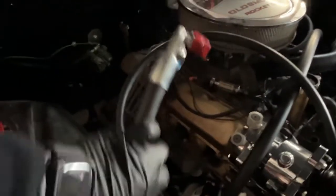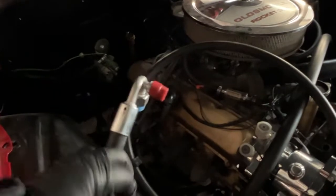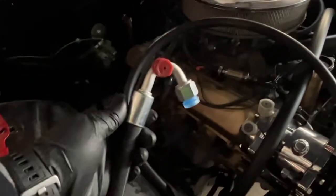And again, here's an installation where you can see it coming out of the firewall. These are the lines that I'll be connecting to the heater to the engine, and this side over here is for your air conditioning system. And then what we do is we make custom hose fittings, and I have a hydraulic crimper that will press these couplers on the end of the hoses at the exact length that I want, so that I can connect them right onto the compressor where I need it, or up on the condenser or the evaporator. So all of these have been crimped professionally so they don't leak.